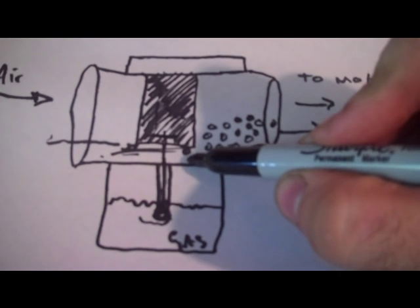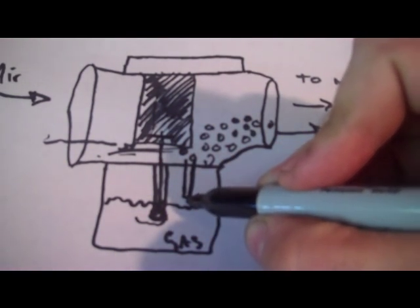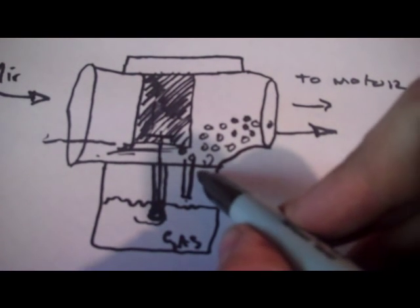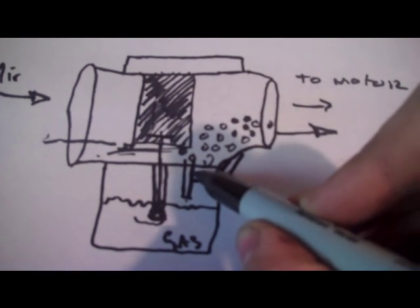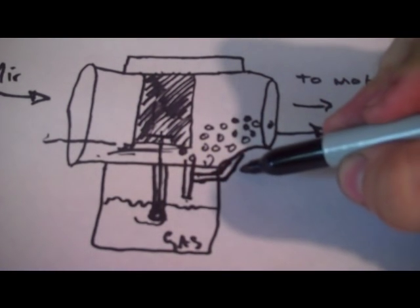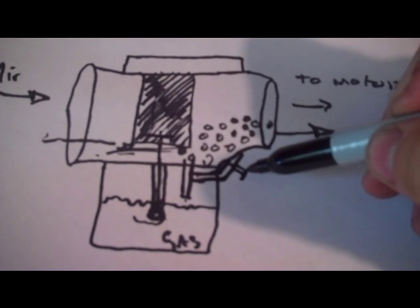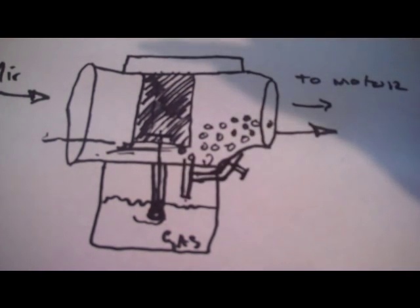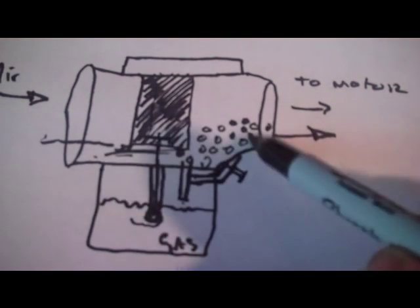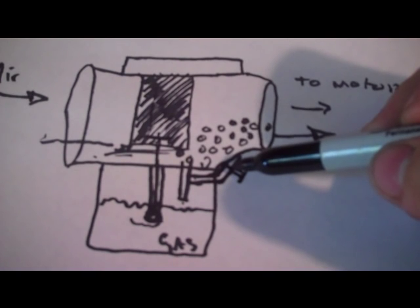Let me think. You have in here something a little bit similar, which is your pilot. On the end of it is one of these, a pilot jet. And that's got a tiny little hole. Connected to your pilot jet, in a lot of bikes, you've got your pilot screw. And that's just sort of a little pipe that goes in through here. And it's got a screw on it with a screw head. And by adjusting this screw, on some bikes it will adjust how much air comes back in through here, and on some bikes it will actually increase the gas mixture. It depends on what side of the carb it's on. But what it will do is it will lean out or enrich your mixture as well. So that's an adjustment point.